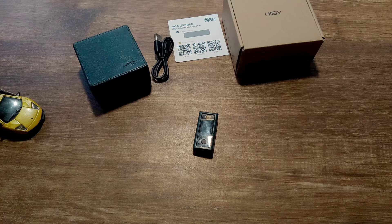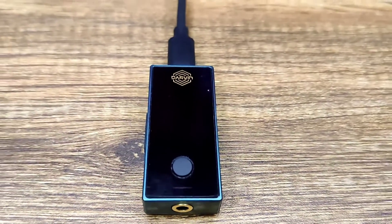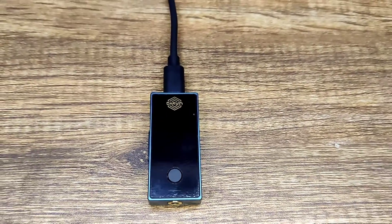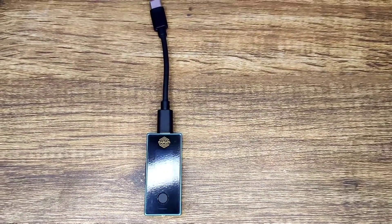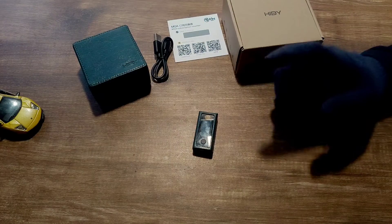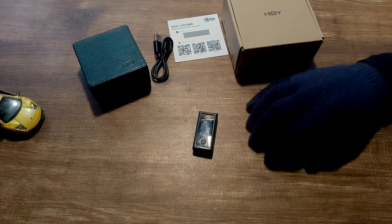When played on a 5,000mAh battery smartphone, it lasted around 15.5 hours at 30% volume. At 30% volume playing with a PINEar Fan Tubo — a very easy-to-drive IEM — it does get a bit warm but not uncomfortably hot. I didn't have any problem powering any IEM, and I hovered around 15 to 17 out of 31 volume steps on harder-to-drive IEMs like the 7Hz Timeless A and the Dunu SA6.